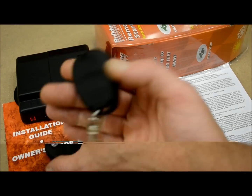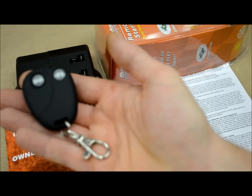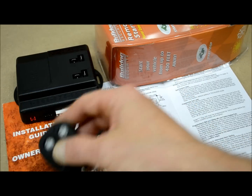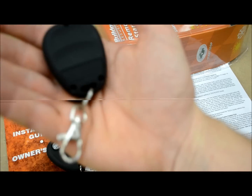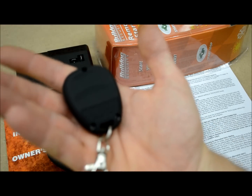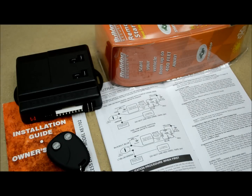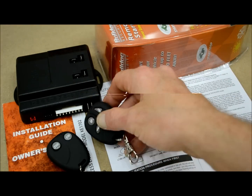And just another note, on the remotes that I'm using, just for your own reference, this one here, the 2 button, is a TX2BD. TX is for transmitter, 2 is for the amount of buttons, BD is for Bulldog. This 4 button that I'm utilizing here, on the bottom it says C705, and above it, it has a really long number. It's J3S004SCHOO.